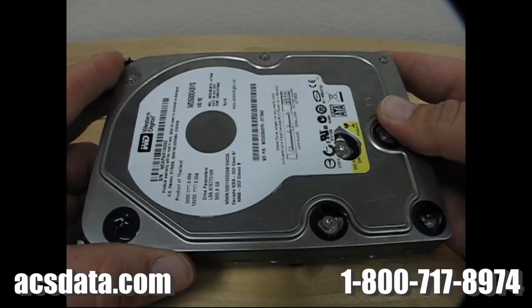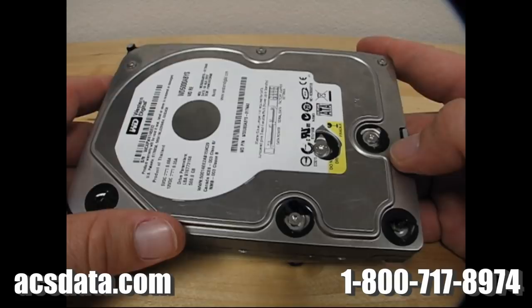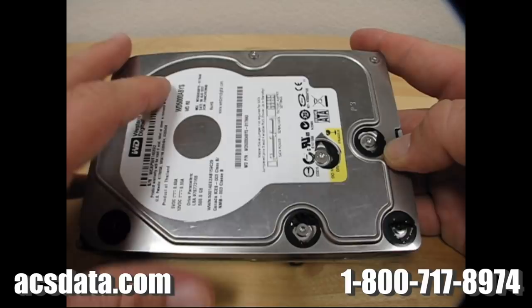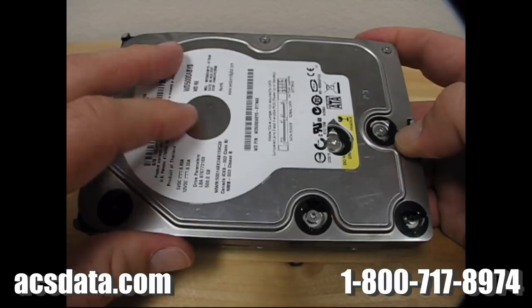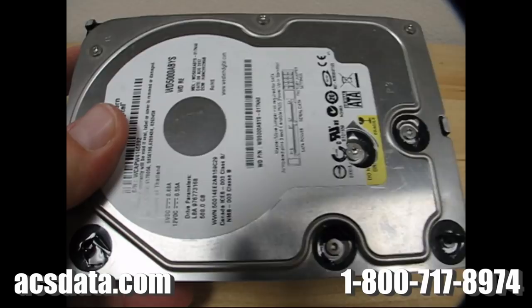You really take a risk by putting it in the freezer because of what it can do when you fire up the drive the first time. The instant we powered it up, it tried to calibrate and then it just lost the heads because the heads hit the area of the platter that actually had the little bit of accumulation of frost. I didn't leave it running long enough to do any real damage to the platter surface.